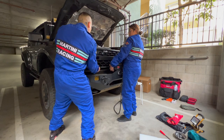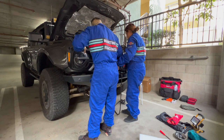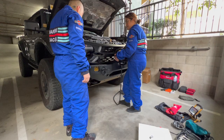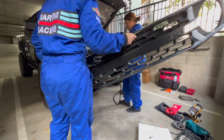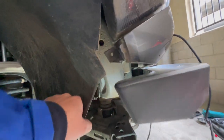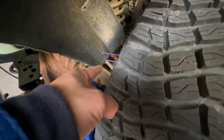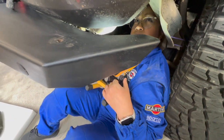Remember there's wiring. After pulling the grill out, we now have to remove the wiring connected to the grill — disconnecting the wires as we remove the grill. We also have to remove the zip ties from the fender liner so we can access the light box tucked inside to remove the RTR lights wiring. Now working on the driver's side — we cut the zip ties holding the bottom part of the fender so she can disconnect the RTR wiring.